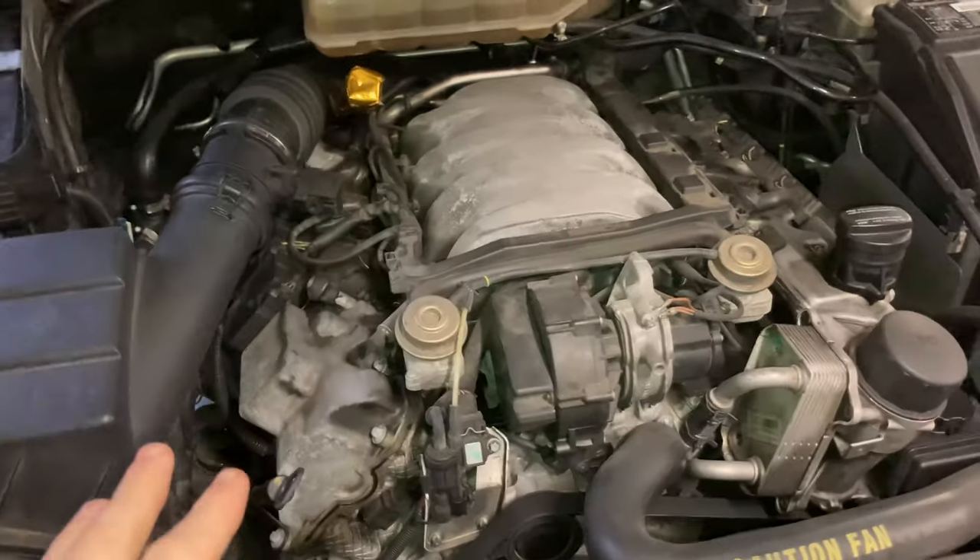To boil it down: if you're using any of the name brands nowadays and looking for a Mercedes spec 0W40, anyone making a European spec 0W40 is probably going to be a pretty good oil — but you still want to look at specs and oil analysis. For the C55 it honestly doesn't matter; I do short intervals, usually change it by 3,000 miles. For the ML55 I usually go six to seven thousand miles, so I want something that lasts longer. The Castrol Edge works perfectly for that, and it's easily available at Walmart.